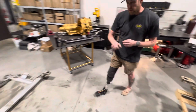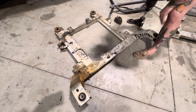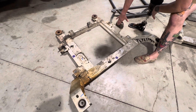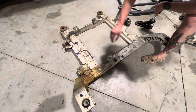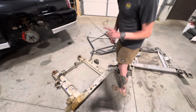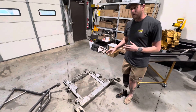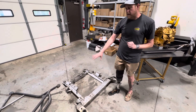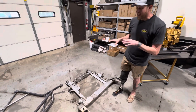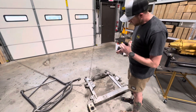If we take a look at this V6 subframe right here on the ground, it kind of illustrates it a little bit better. You have your transmission mount over on the driver's side of the transmission case, and then you have the clevis that accepts the mount underneath the harmonic balancer. That's it. One thing that GM did get right with the LS4 is that they finally moved to a triangulated system. And once they abandoned the LS4 and went to the high feature V6 — the 3.6 applications — they also triangulated the mounts, because it is much more conducive to performance.